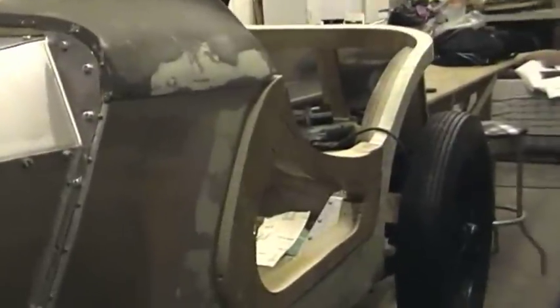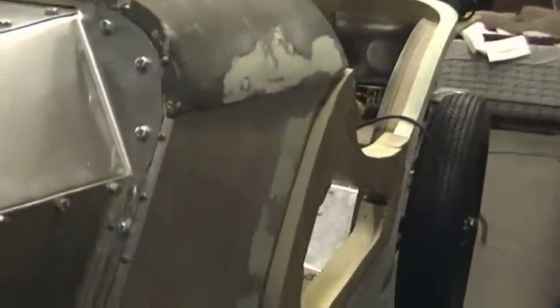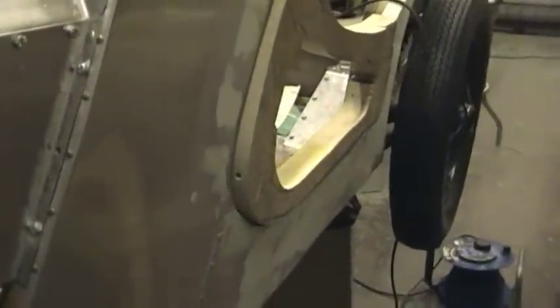The door is very much oversized — if you look here you can see it overshoots the body. This is going to allow me to mark it out and trim it in to exactly the right size so that it's got all the curves and contours of the body. There are no compound curves in this but the body sort of comes along and there is a sort of fold — a folding door shape but no contour. It's quite a simple door shape although there is a twist along the whole length. With the oversized thickness of the frame I can just mark it out with a pencil and plane the door into shape.